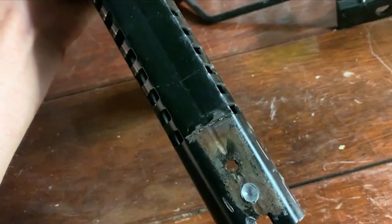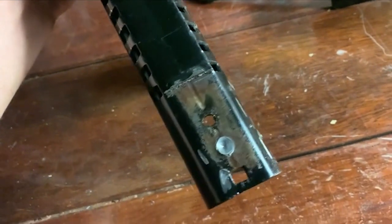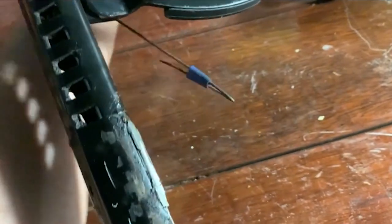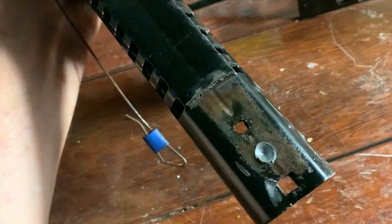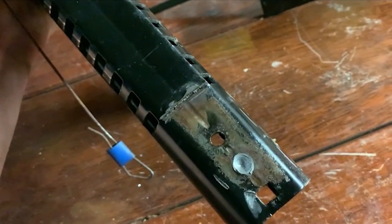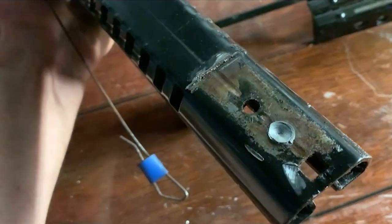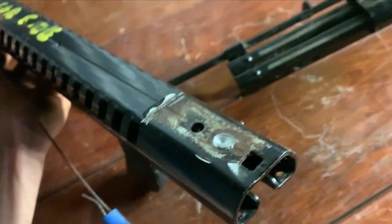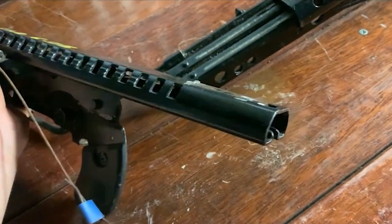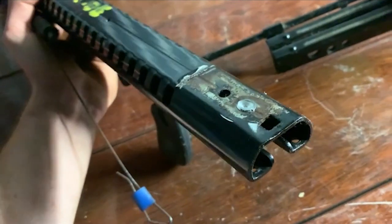here, they had a weld at that far right, at that far top point, and they had a weld here. I'm going to copy them again, once again, if I can, along with the little riv nut thingy and the spot weld, but instead of the riv nut thingy, using a tensile bolt and nut instead. So yeah, basically gonna try and mimic together a bracket to fit the 36 really.